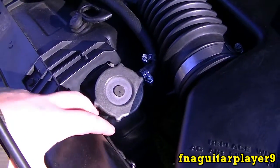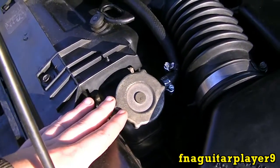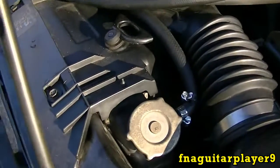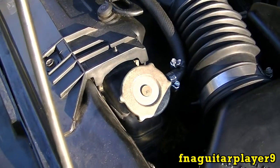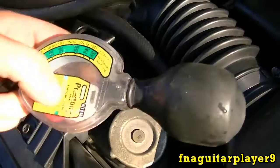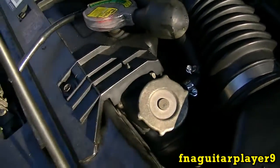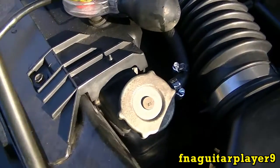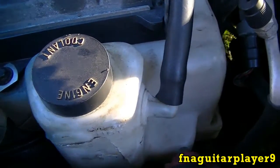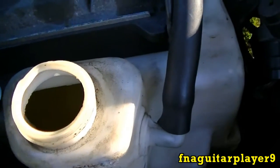This is your radiator here and this is your radiator cap. Before I do anything else, let me let you know ahead of time: do this when your engine is cold. If you do it when it's hot, as soon as you take this off it's going to blow up in your face. And if you're pumping hot antifreeze out, it's easy to get burned — or you can melt the tool if it's too hot. So always do this with the engine cold. To test it, you can get your antifreeze out of the radiator or out of your reservoir if it's full enough.